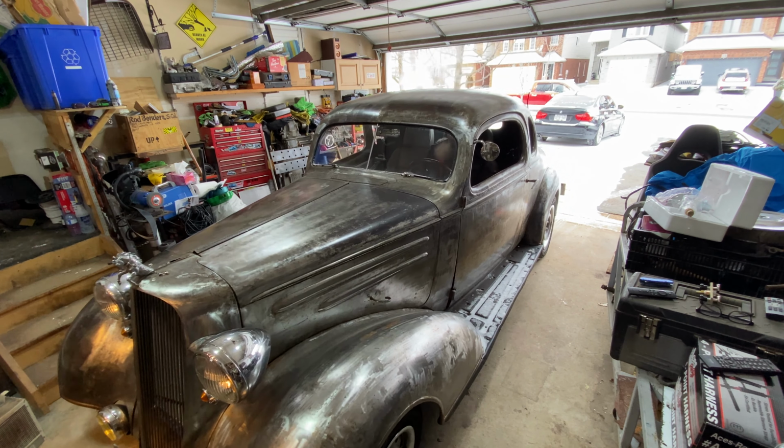Let's start by removing all the spark plug wires and the other wire connectors under here. Probably a good idea to mark all these. I'm just going to take these off one by one, tape them in a line to this bar, same on the other side, tape them in order, make life a lot easier to reinstall the new one. Right, let me do that.